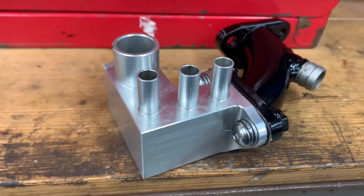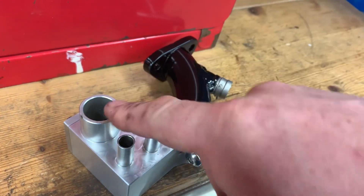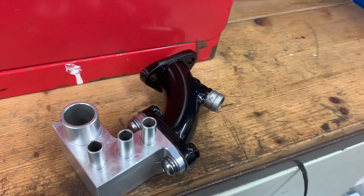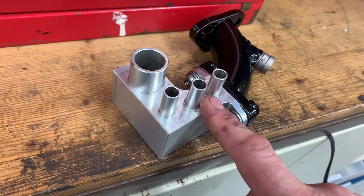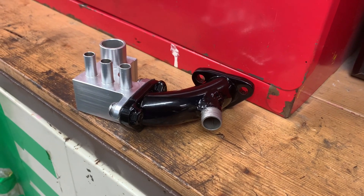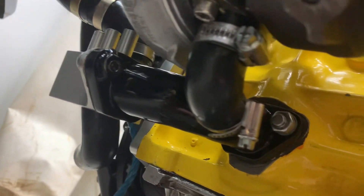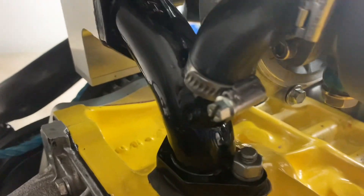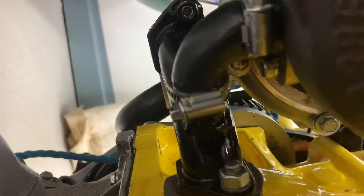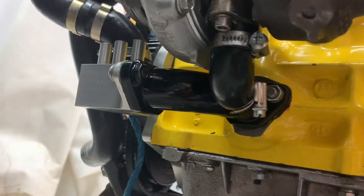This is now ready to get fitted — I gave it a good thorough clean out because we've been welding, grinding, and it's been blasted and powder coated. I've cleaned the faces up so they're absolutely mint. And just a shot with the little collector bolted on to show you exactly how that fits — the main return from the head comes from the side casing on the head down to this collector. One of them is a breather and the other two are the returns from the head. That's a nicely made part by Specialist Components, that's why I wanted to retain it. It flows nicely — the elbow is a bit of a pain to get on, but once it's on it's two hundred times better than it ever was before. I'm calling that a success.